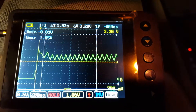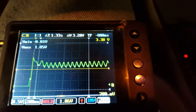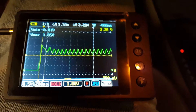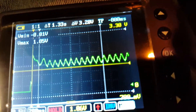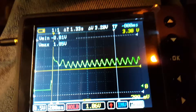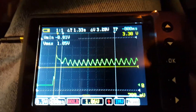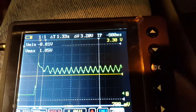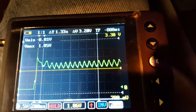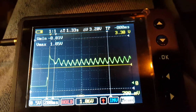There is some math you can do — if you're interested, hit me up and I can give you a link to a site where one guy has an algebraic equation worked out to figure out what your PSI is based on the reference points you're getting off this scope. Because just looking at this scope, I'm fairly confident I don't have a mechanical misfire, but what I'm not confident about is — say this was a high-mileage engine where all cylinders were experiencing a little blow-by or had weak rings or weak springs. This test doesn't tell me that.